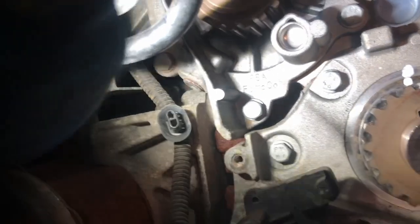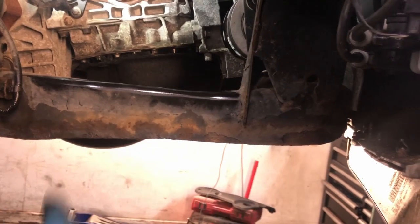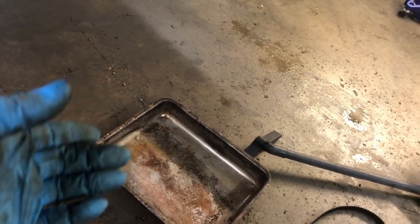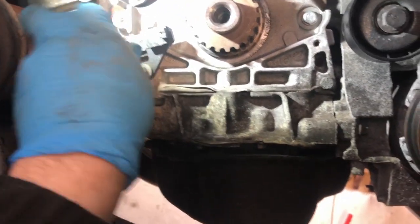You can see 'PSA FOMOCO' on there - so it's a Ford and Peugeot engine. I tried to undo the drain off the radiator and put a pipe into a drain tin but nothing came out, so I'm going to have to do it the messy way. I'll remove this and swing it out of the way, put the tin underneath it and just let it all drain. I'm not keeping the coolant - I'm replacing it, and I've got the wet vac. Even if I got it all out of the radiator it wouldn't remove it all from the block anyway - there's no way around it, you're going to make a mess.